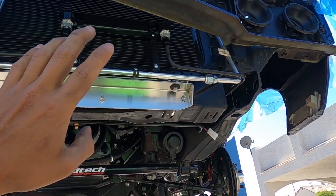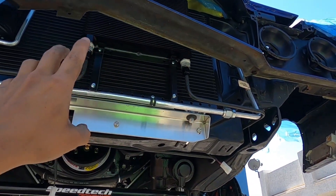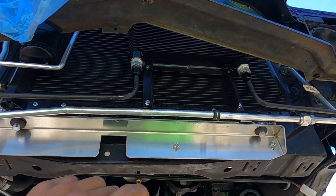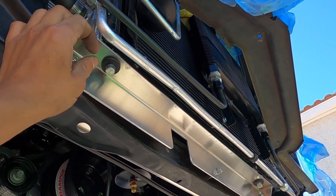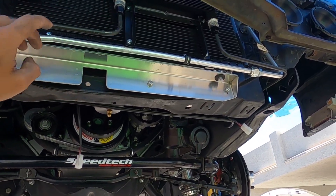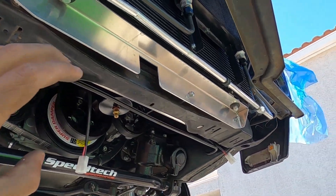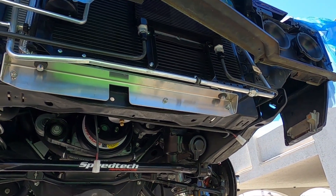If you guys are not running anything above 500 horsepower, you really don't need it — I've done plenty of stuff without running an aux cooler. Now, I talked about this cooler briefly in the last video and I also put a link in the description. This one's mid-range, probably around $170 shipped. The purpose of this cooler: you can go straight to the radiator, which is fine, but that radiator is going to be working hard for the motor, so if we can assist it, we'll do that with the aux cooler.